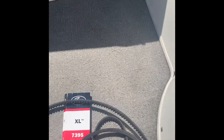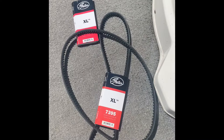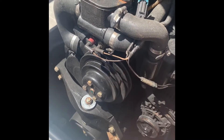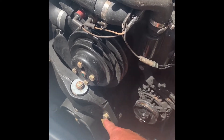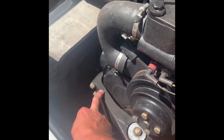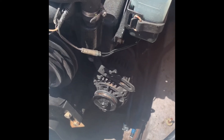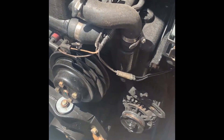These belts on Amazon are about $11 a piece, and I have two of them — because for $11 I'm not going to be stuck on a lake. What I'll do is put one belt on and zip-tie the second belt out of the way so I have a replacement. It's a very easy swap — just loosen a half-inch bolt and slap the new belt on if it ever happens out there.